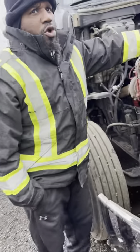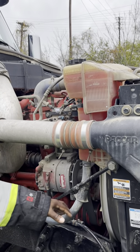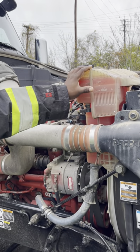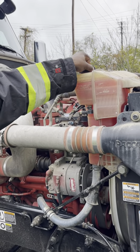My wires and hoses: no bumps, no abrasions, no cuts, no exposed wires, no leaks, properly mounted and secured. My engine reservoir is properly mounted and secured. Here's where I check it, here's where I would fill it. It's in good condition and the cap is secure.